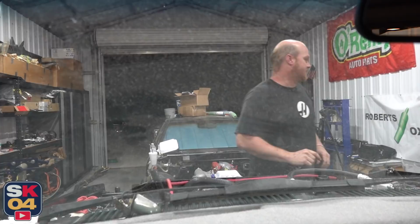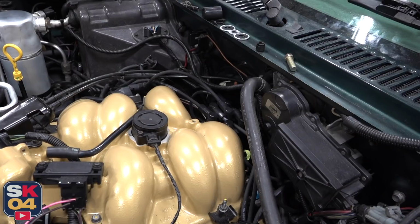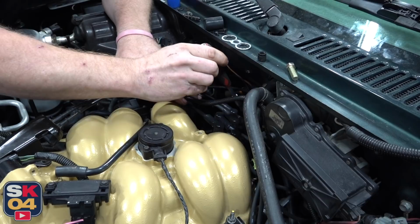What? The distributor is 180 degrees out on timing. That's why it's only popping off one cylinder. If we were crossed up on wires, yeah, it would pop off on 2 to 3 cylinders, and it would have tried to fire. Being that it's only popping once, we're 180 degrees out, so I got to lift the distributor back up out, spin it around. Oh, okay. Yep. Nothing too horribly major. Woo! Not end of days.